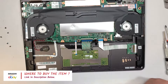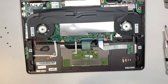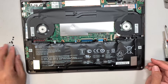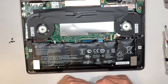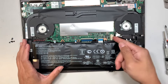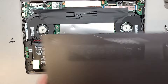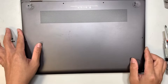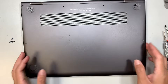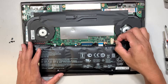The replacement battery part number is KB06XL. To reinstall, just reverse the process: put all the screws back in, slide the connector back to the left and push it all the way in, put the cover back on, and replace all the screws on the back plate. No configuration or settings needed — it's just the battery that needs to be swapped out.